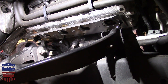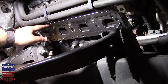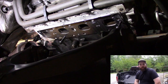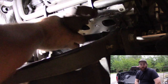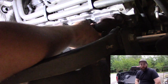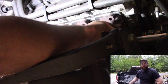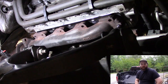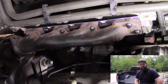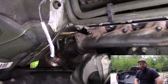Time check 2:03. Got the gasket on, got two bolts in the slotted holes, and we're about to slide the manifold up. One tip I wish I'd known before learning it the hard way: loosen your collectors from the Y-pipe on both sides before you even start dealing with the manifolds. I left the driver's side connected while doing the passenger side, and it got the Y-pipe bound up, making it more of a pain than it needed to be. There's your tip.